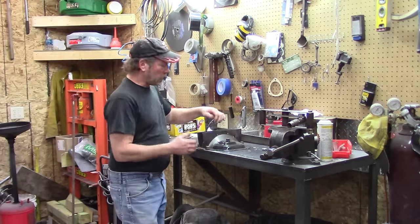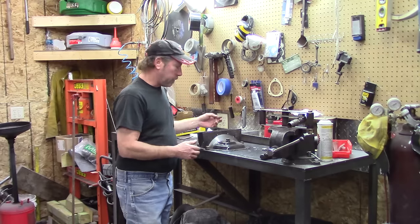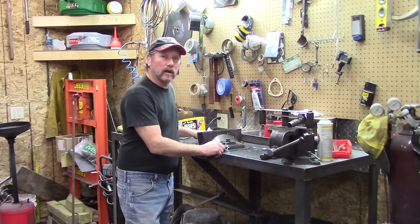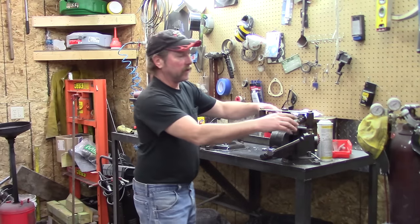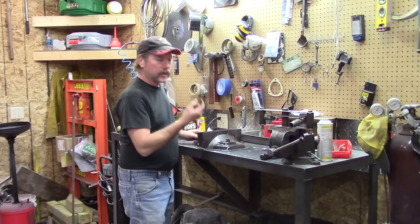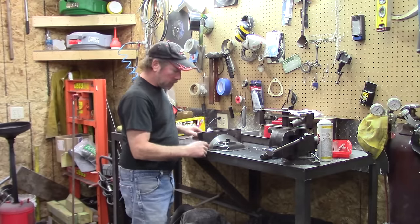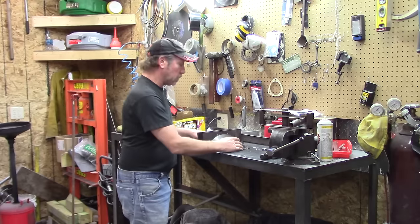The center of the Dana 60 rear axle is right on that ring gear. This cover is just a little sheet metal cover — not strong enough to just weld a bolt on it and have this pivot point. So I have to make these thicker buttons that bolts will go in, and then the rest of the bolts will help carry this whole load.